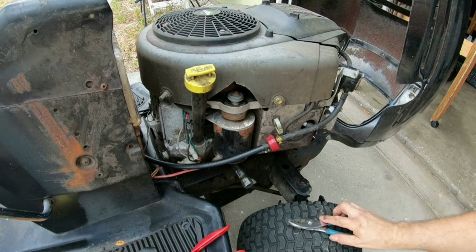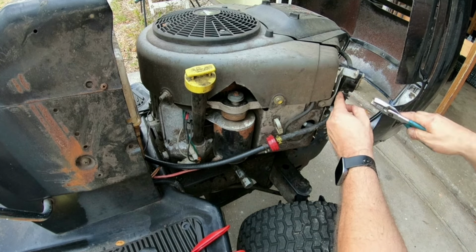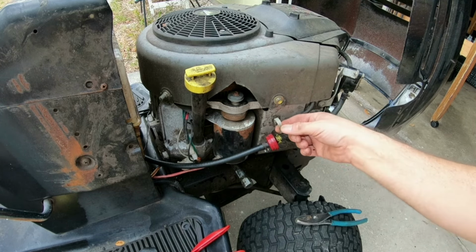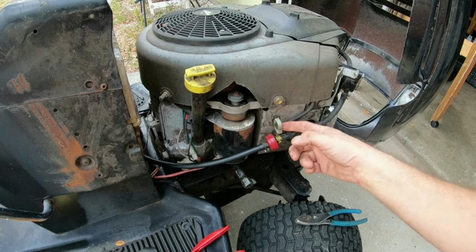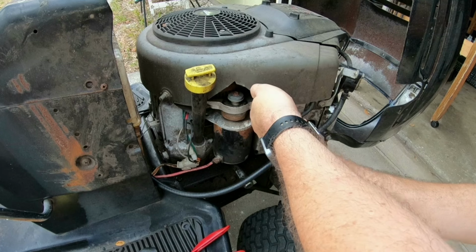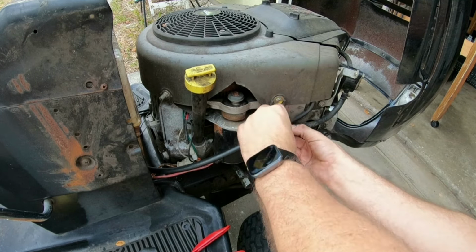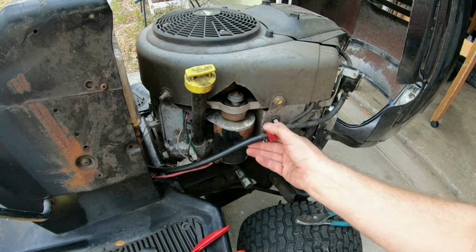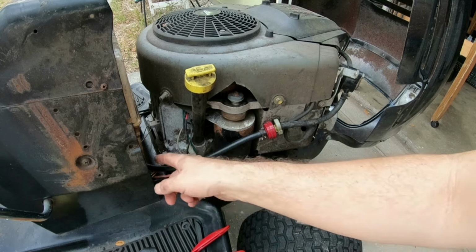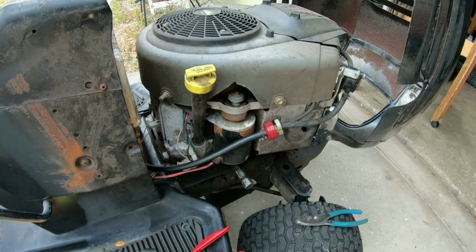There it goes. It popped back on. All right. Now take the clamp, put the clamp right there. So now that's secure. Now there's a little plastic clamp here. So what I'm going to do is take this clamp, open it up like this, put the fuel line hose in like that. Keep that right there like so. And now all I have to do is go on the other side and hook it back underneath the fuel tank, and then we're done.